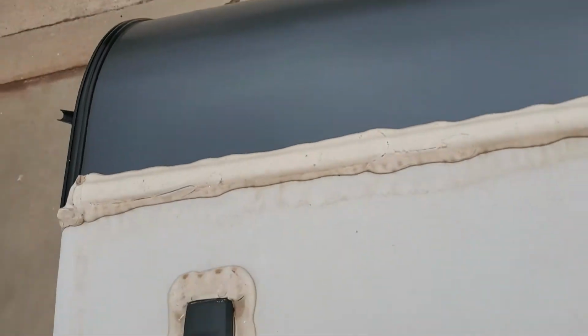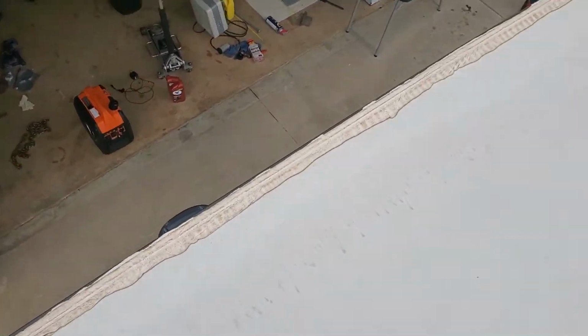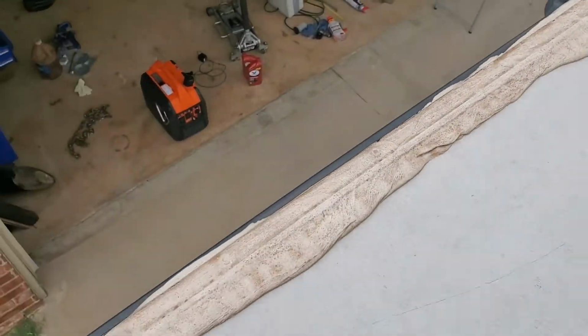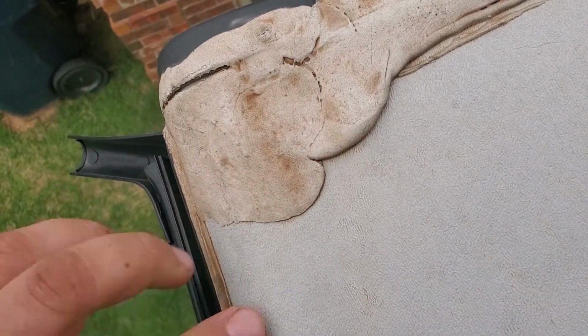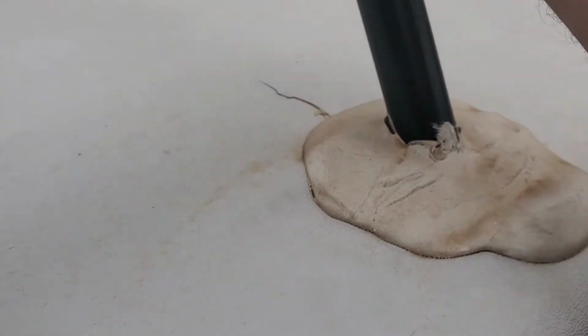Front cap not sealed. Roof is soft in some spots. In other spots the roof is fine, but I swear they didn't put rafters where the plywood ended. Doesn't make any sense to me. Also, where a couple of those bad sealing spots are, the membrane is also loose. I'm trying to do this off the side of my camper, but here in this corner, the membrane is all soft. I don't know if that's because of water damage or not, but it's all not sealed down. Does the same thing all around the poorly sealed ladders. Let me jump down off of here.